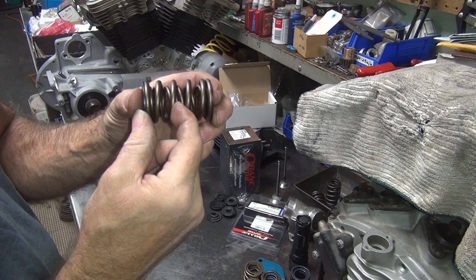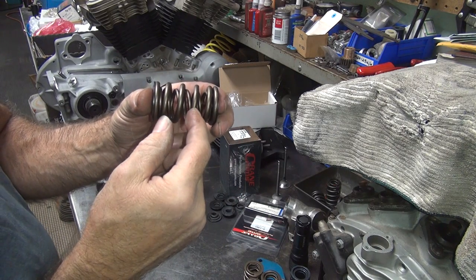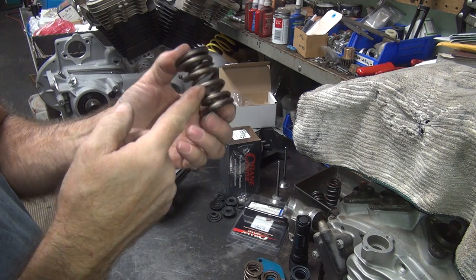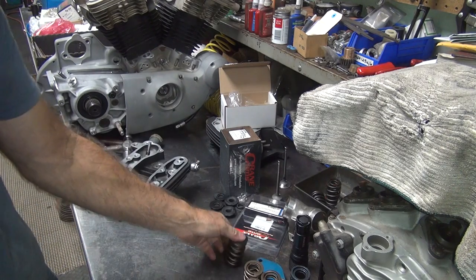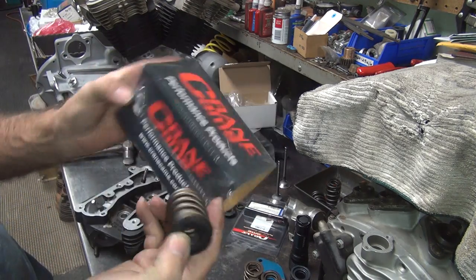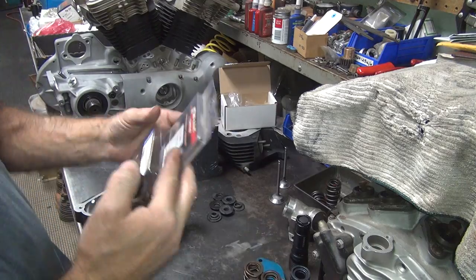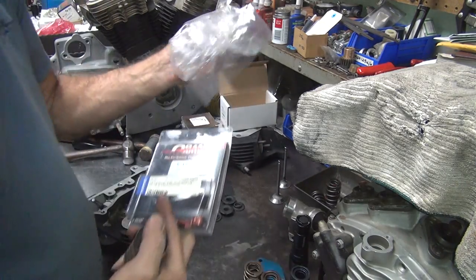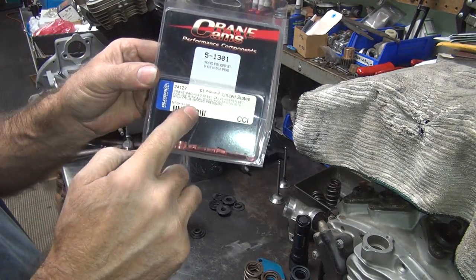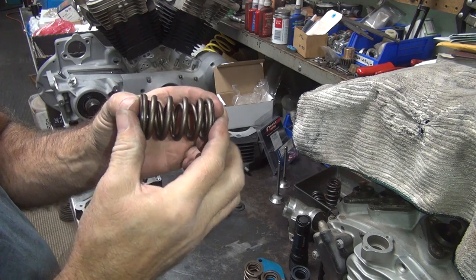So if you back-figure from there, you take your valve lift - let's call it 600 - you add 600 and 1.125, it makes 1.725. That is our minimum installed height for the spring room and travel we have. Now this is a new set of Crane springs - these are 175 pounds on the seat. This set was 155 with the silver keepers, which I'm not going to use. I'm going to use the red keepers, which are 175-pound spring keepers. That changes these from 155 to 175, and what it does is it compresses the spring 50 thousandths to get the extra pressure.